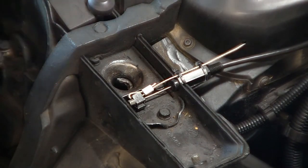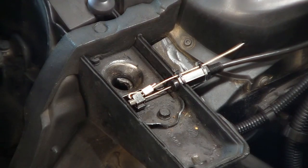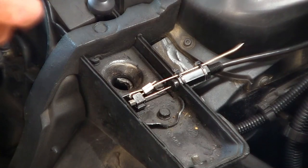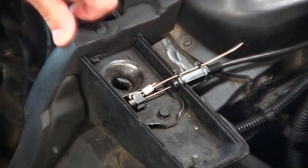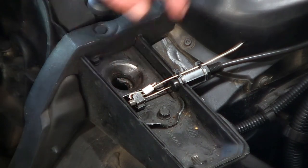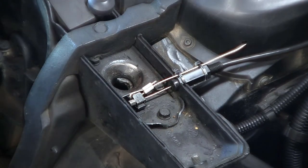There are a couple of ways of doing it. What I did — my tip — is I got a cable. As you can see, this cable here is a small cable, a very strong wire, going around to a little handle here that I made. The latch stroke — you can open this up by hand. I've got one on both sides. It's very easy to put together and you hope you never have to use it, but if you do, it's there. The interesting part of this homemade one is that it actually goes around and inside that particular apparatus that opens it up. So when I pull on this, it's locking on that — not looping over the spring — it's locking on the actual apparatus, which guarantees it's not going to pop off when you open your hood on a normal basis.